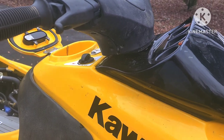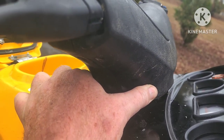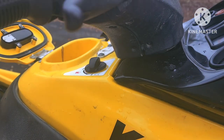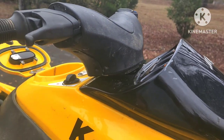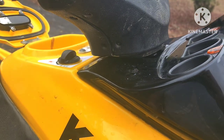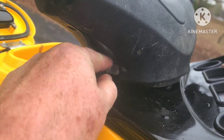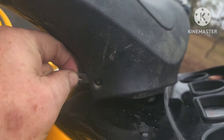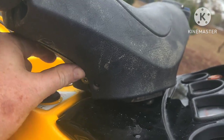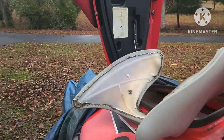I'm finding it impossible to put the bottom screws back in because you've got to squeeze this together, make sure the holes are lined up, and try to put this on with a Phillips screwdriver at the same time. So to do it yourself you're also going to have to use tape - it'd be easier to get somebody to hold this for you while you line everything up and screw it together. The metal plate is very thin and it moves around up and down, and when you try to screw in and you're off the hole any bit, it pushes this away from you, making it nearly impossible to get the threads started.